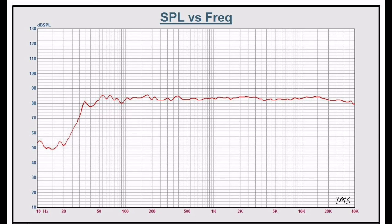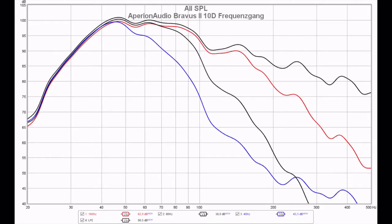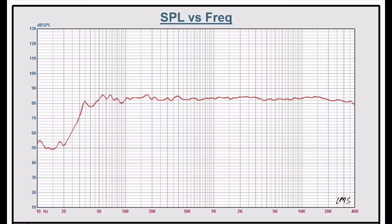Next, we'll set the frequency point for your subwoofer. You'll want to review the specifications of your main speakers to determine where in the frequency spectrum your sub needs to be active. For example, the Novus Bookshelf speakers we're using today have a frequency range of 45 Hz to 33,000 Hz, and the Bravus 10D subwoofer has a response of 28 Hz to 350 Hz. By adding these two together, you can nearly cover the 20 to 20,000 Hz frequency range that the human ear is capable of detecting. When examining the frequency curve of the Novus Bookshelf speakers, the low-end curve falls off from around 45 Hz. Knowing this, we can confidently set the subwoofer's crossover frequency point between 40 and 60 Hz. The goal is to have the subwoofer pick up where the bookshelf speakers leave off, so that you're not missing any of that beautiful music you're about to enjoy.